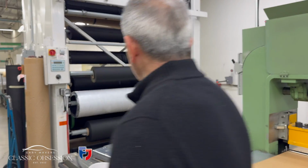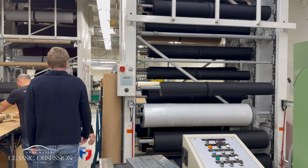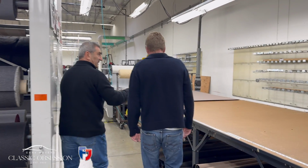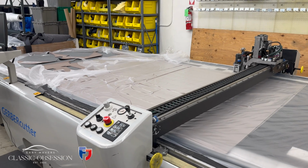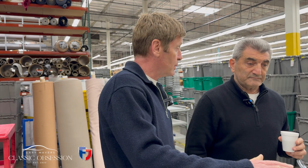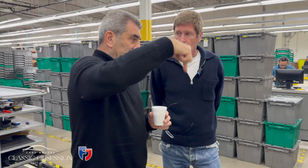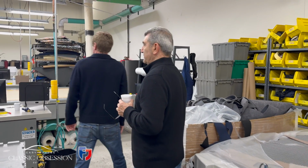And this is an automated carousel for convertible tops and headliners. They will fit it here. This machine here will do the stock cutting. So they can do up to 10 layers, like 10 tops, 10 headliners at once. And they're all really accurate as well. It gets very little disturbance when you do jigsaw cutting rather than rolling over it. Another cutting machine, there's three more machines there.